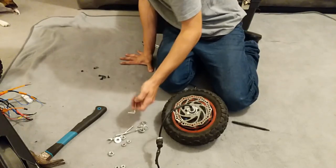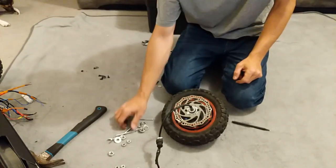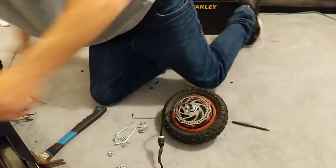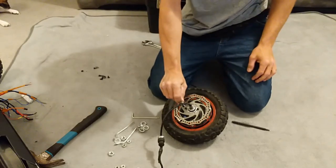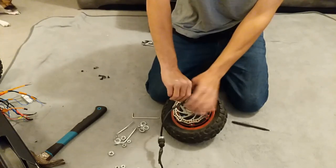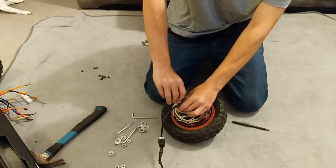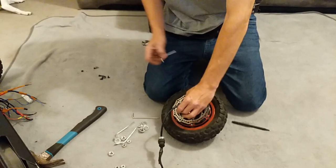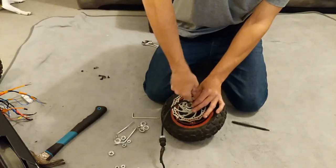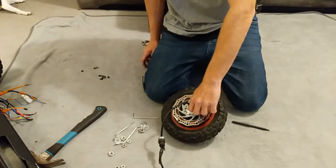Next thing is the brake disc. Your normal fastener is an M5; I've swapped mine out so I'm on Torx bits. Anti-clockwise to undo on most things. I've taken six out already and left two in so it didn't wobble on the scooter. Keep them all safe — but this is also how you can change your disc, by popping the wheel off this way.